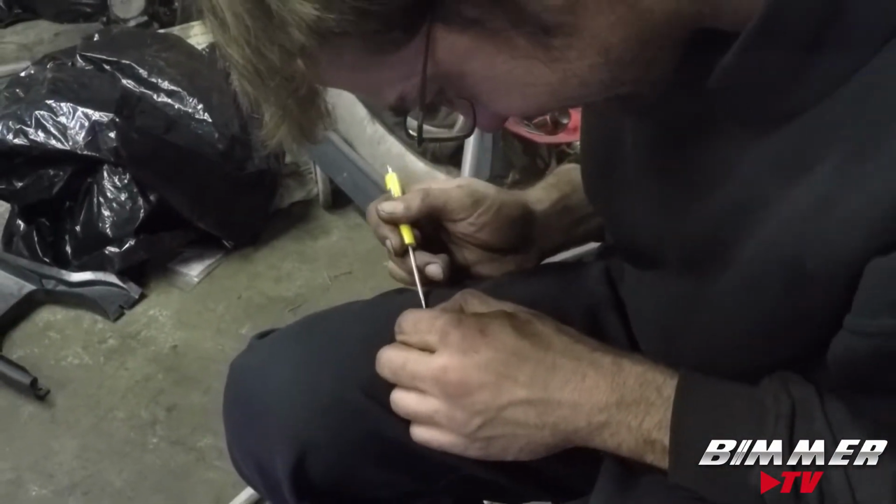Okay, so be careful when you're putting in the clutch relay position sensor that you put it in the right spot, because El Jefe did not the first time, and he was having trouble getting it back out. He pulled on the wire too hard and ripped the wire from the pin. Did you get the pin out? You did, right? Obviously he's got to recrimp it to the wire now, which he's working on. So just be careful. Make sure you're putting that clutch relay wire into the right pin spot. Make sure to count. Make sure it's number 8, not number 6.